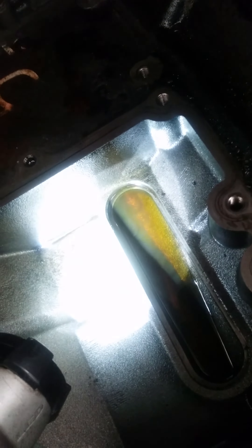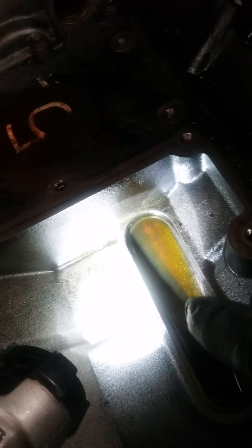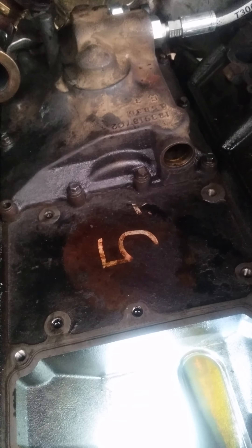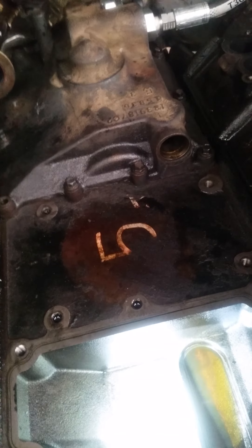You can see there's fresh oil in there right now. If that pump is bad, it's going to throw air through this oil because it's going to come out the front seal. I want you guys to understand that on the O3 pumps, you want to add a little bit of oil to the top of the line on that pump when you put it in, or you'll get a false reading. Air will go through the front pump seal just a little bit — you won't be reading zero, but it may not read the whole thing, because it takes that oil in that seal to make it really seal perfect.